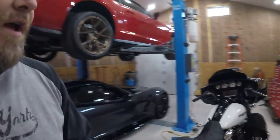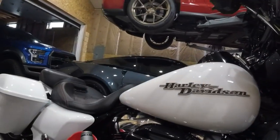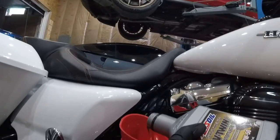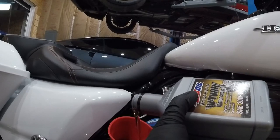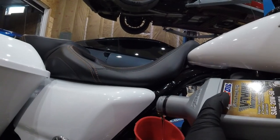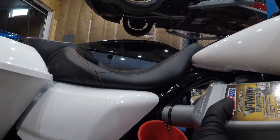I believe it takes four and a half quarts — I have five quarts here. I bought this long funnel specifically for this. I don't trust dumping it into the opening down there, so I'm pouring it through the funnel. This is really thick oil — 20-50. So I've got four and a half quarts to do. I'll do a rough check on the dipstick — it should show a little high right now since the filter is empty and will fill once the engine runs.